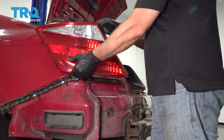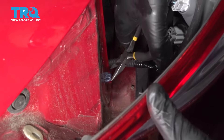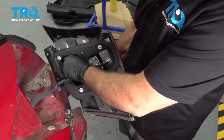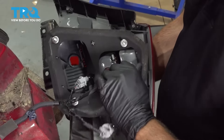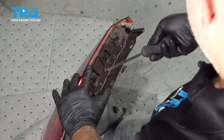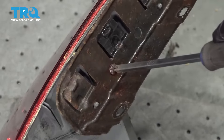Go ahead and grab our taillight and pull it straight out. On the backside, pull our bulbs out. There's a wiring harness with a little retainer clip — use needle-nose pliers and press in on the little lock tabs, then pull that out. Get your three bulbs: reach in, twist counter-clockwise, pull — counter-clockwise for each one. We had a hard time loosening this screw — I was able to tighten it just a tiny bit to break it free. Then apply some heavy pressure inward to remove the bracket and swap it over to our new taillight.